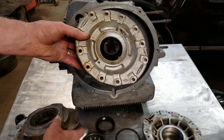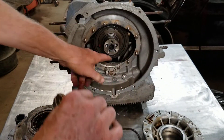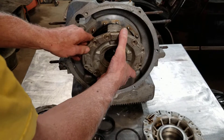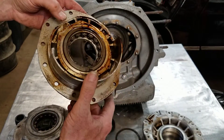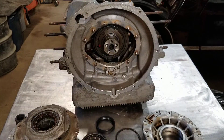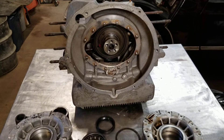If you'd leave it in the comments — I don't know what year or style this rear housing cover is off of. It has this larger piece on it right here, as opposed to the others. It goes in sideways, and there is an oil feed hole so that goes on the bottom and matches with this oil feed hole from the oil pump, and it would be blocking off that side of the crankshaft area. If you know what this is off of — I'm guessing it's an earlier Panhard — let me know in the comments. I'm still learning on this. I do have a service manual but that's only good for a certain amount of reference. I'm going to stop the video here and next time I'll show you how I check the end play on it. Thanks.